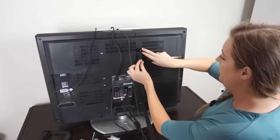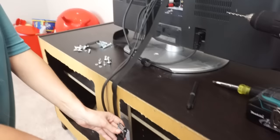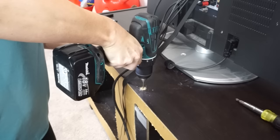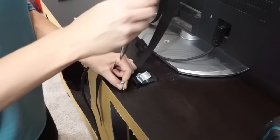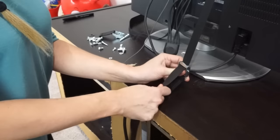I'm taking the screw, placing it in the hole, and screwing it onto the back of the TV. If your piece of furniture had a solid backing, you would place the small piece eight inches below the TV, but since ours doesn't, we're mounting it right on top. Line it up with the strap, mark it with a marker, drill two holes, place the piece on top, put the screw in the hole and bolt it down. Then push the button, feed the top strap through, pull it tight so it's taut, let go, and now it's secured.